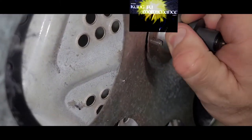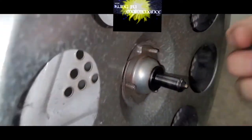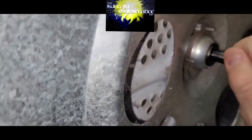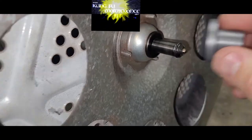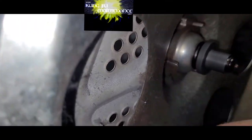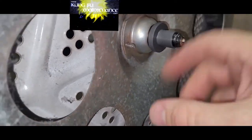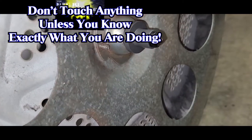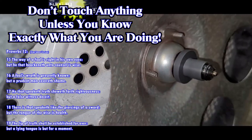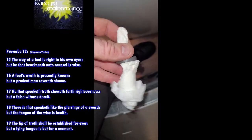All right, for a squeaking dryer, here's what needs to be replaced: this part, which is deformed, and the little O-ring on the front. I'll try to put a link for those in the description below, but it's just a matter of changing those out, and you don't really want to use any kind of lubricant. It's better for it to be dry. This one's a little deformed, so I might need to order a new one. That's the story on this dryer. Sometimes all it takes is popping it off and cleaning it up real good.